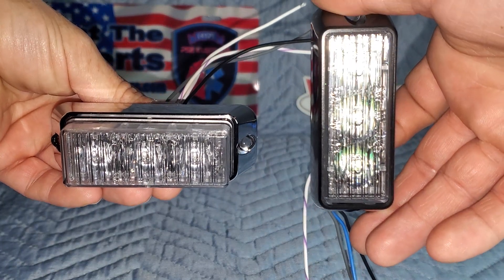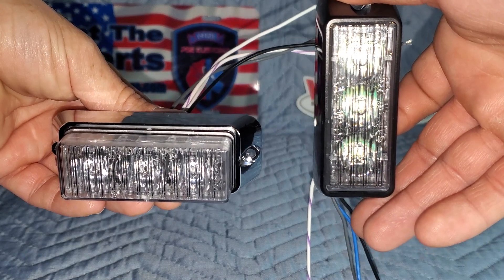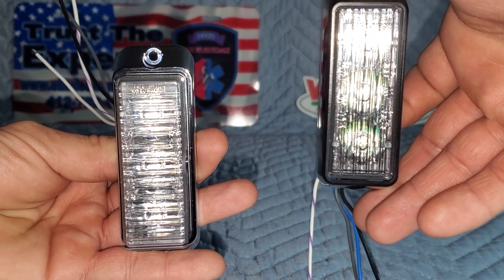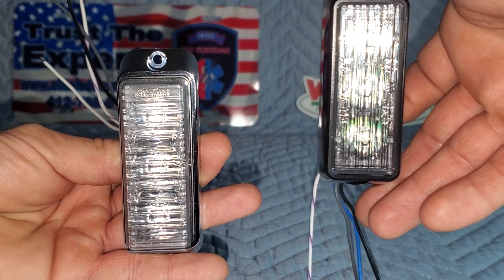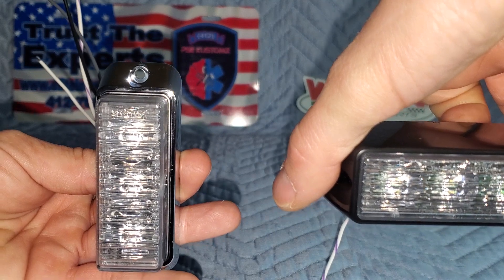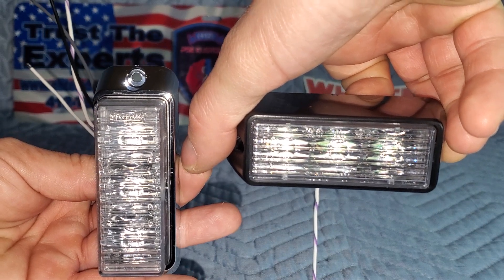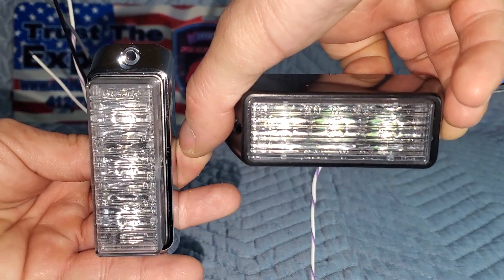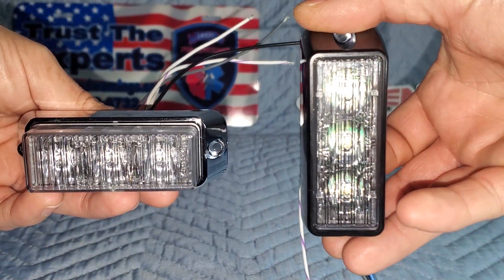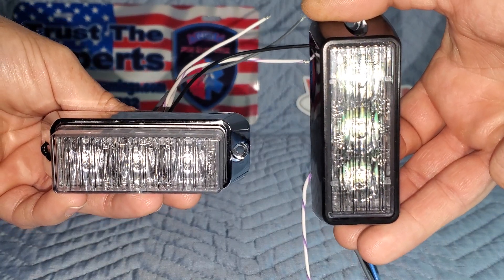See how whenever I have this one vertical and this one horizontal, the flutes are going in the same direction. The horizontal mount, if you mounted it vertically, would give you a wide spread up and down. This one, if mounted horizontally, would also give you an up and down wide spread. For the performance of these lights, that's not what you want. You want these each mounted the way I have them now — that's what gives you your wide spread beam left to right.